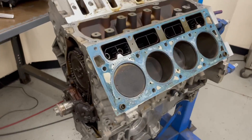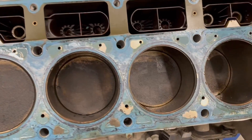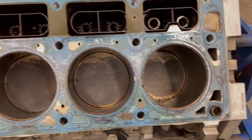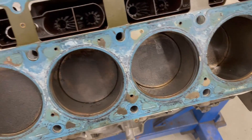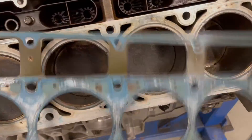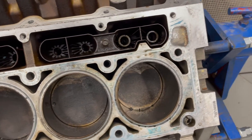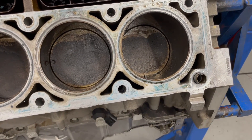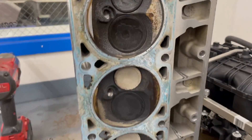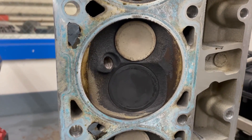Let's take a close look here. Flat top pistons - we expect that. I think that this is an aftermarket head gasket. This thing might have been rebuilt at some time in its life. Looks like a newish deck surface too. This is not what we normally expect for junkyard motors - my guess is this thing has probably been rebuilt before. It looks like it's in pretty good shape. But look at the cylinder head over here - this exhaust valve has got some buildup on it. If you look at the others, normally they're white and clean.